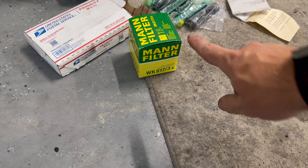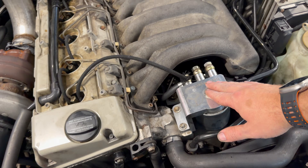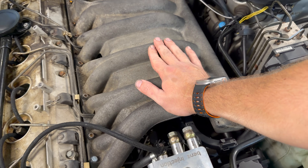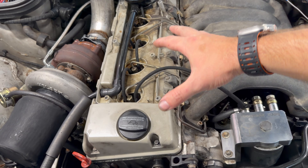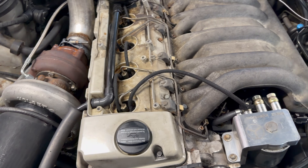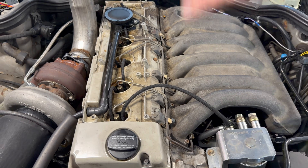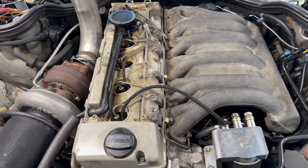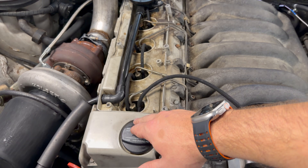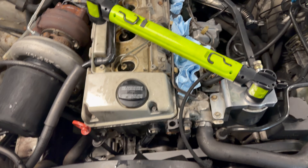The injector socket removal tool and everything can be found on BensInjection.com. It is recommended when you change out your injectors — Shane said change out the fuel filter as well — so we're going to be doing that. We're going to take off this intake manifold so we can get to the injector tie-down brackets. I already took the top cover off. We'll remove the crankcase breather, pull these hoses, and then remove these hard lines.